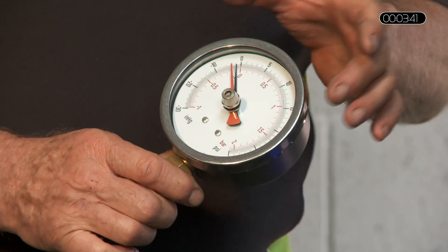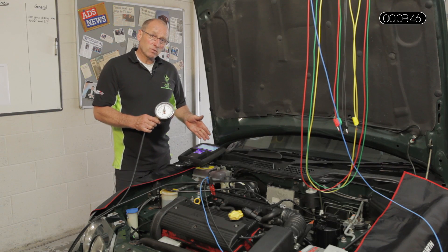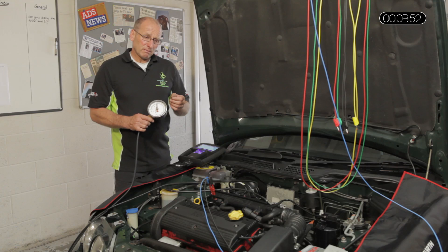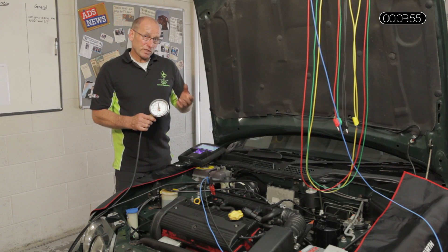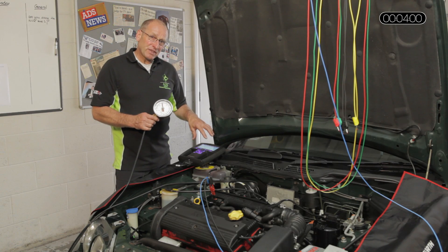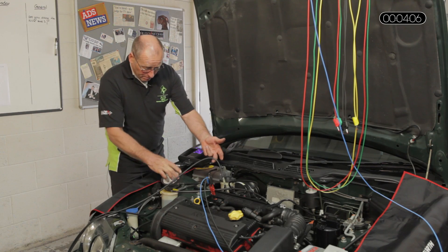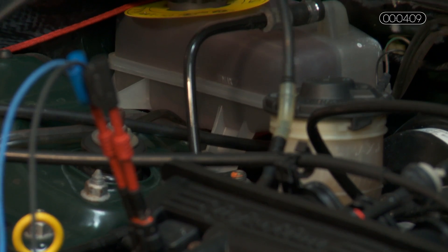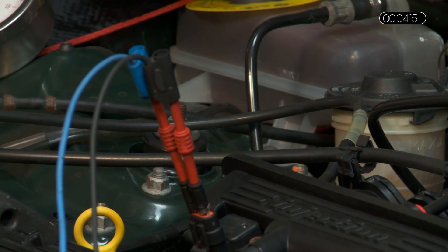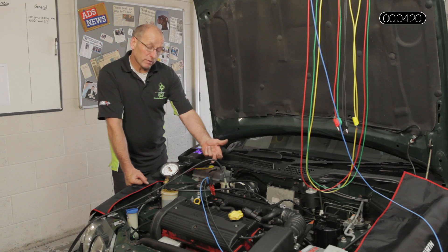The common sense here is that this real-time value should be reflected with data from the scan tool. That gives us confidence that the sensor sensitivity, plausibility, and wiring are all accurate, so we can trust the data serially. The gauge is connected by a simple piece of hose that tees into the manifold circuit. This is a direct-fitting MAP sensor — there is no hose connecting it to the engine, though in some cases there are. Nonetheless, we are still measuring the same environment: manifold pressure.